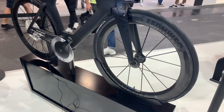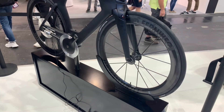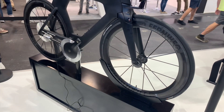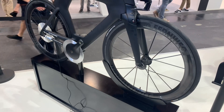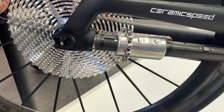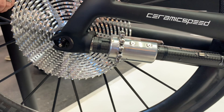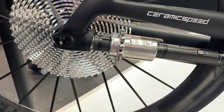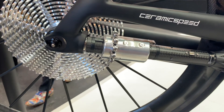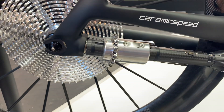The other big news from last year is that the system is now shiftable. What you see here is a shifting prototype that they're currently charging, but we got them to do a quick shift for us. The way it works is you can't just slide the whole roller ring on the back across the different teeth — it actually has to engage with the new cog as it's disengaging with the last one.